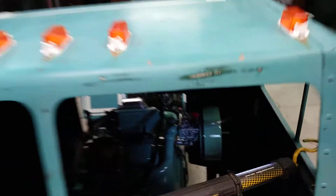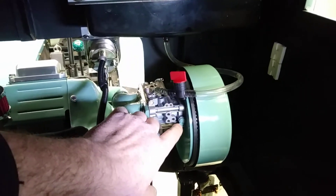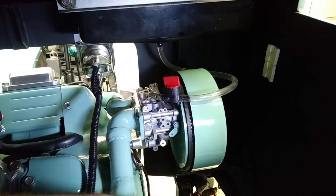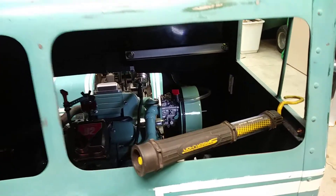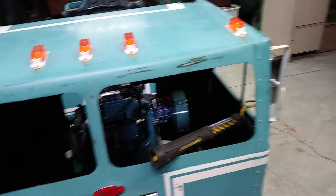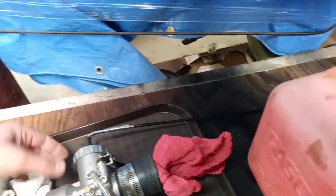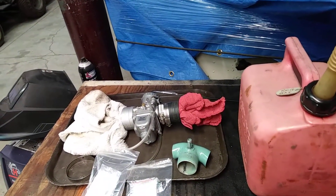I've got to come up with a choke cable. I pulled the choke shaft out and had to cut the arm off and re-welded it before it came forward past the point where it would have hit, so now it's clear. I also need to come up with a new throttle cable — the other throttle cable is made for the Mikuni, and since it goes with that carb, I'm going to try to sell it. I'd rather keep it with the carburetor.